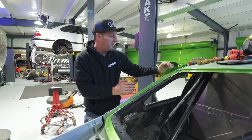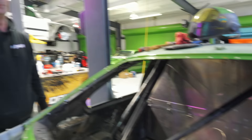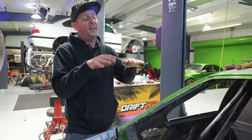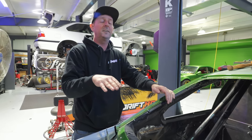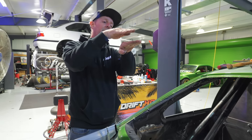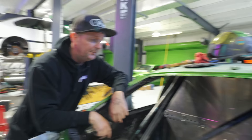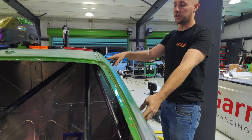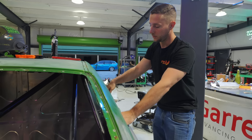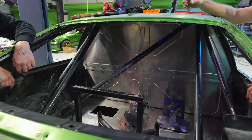So now we have all of that done. Underneath there's a structure to support everything because batteries are really heavy, and then we have a plate that goes underneath that's going to hold all of our radiator lines and fuel lines. We're very excited — we got all of this stuff done and it's 18-gauge aluminum on top. We also bead rolled the plate that goes up underneath where the battery tray is, so it would rest flat on the battery tray and the bead roll didn't sit above the metal. That way when you tighten it down it doesn't squish and show a bow in it.